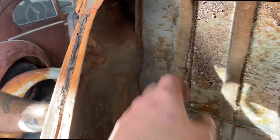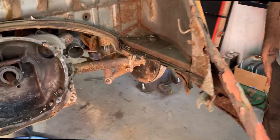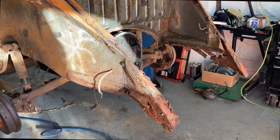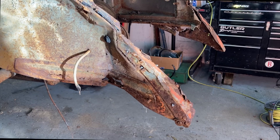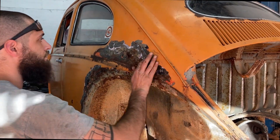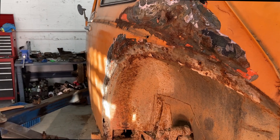You can see where the outside crease is because it's right where the firewall is. That's pretty smooth on this side though. There's just not a lot of supporting metal back here. Well, not now. We weld in bumper brackets - that will essentially help us straighten this out. Do the same on the opposite side and then try and replace some of the sheet metal. In actual fact, that will come out pretty straight. We're going to have that all over the front as well, as we know - so it's going to be front and back.